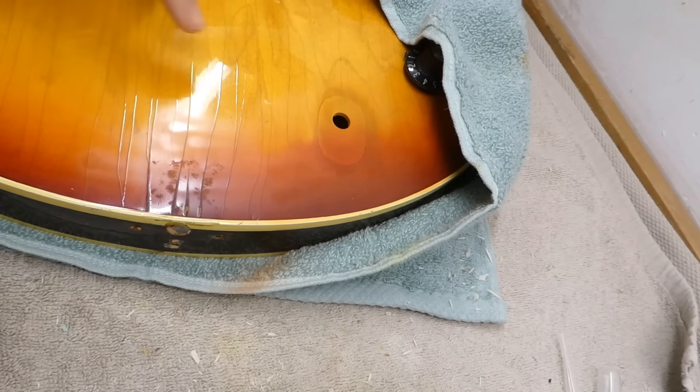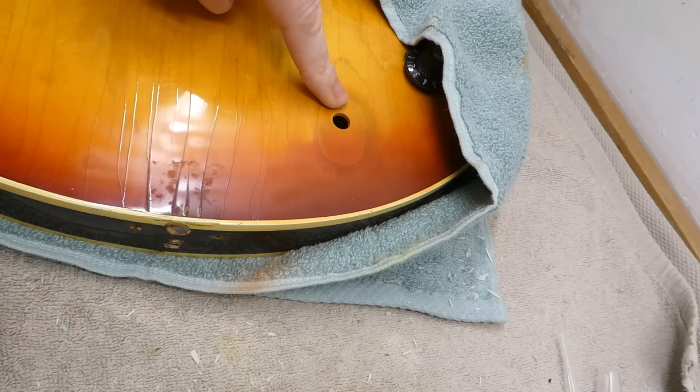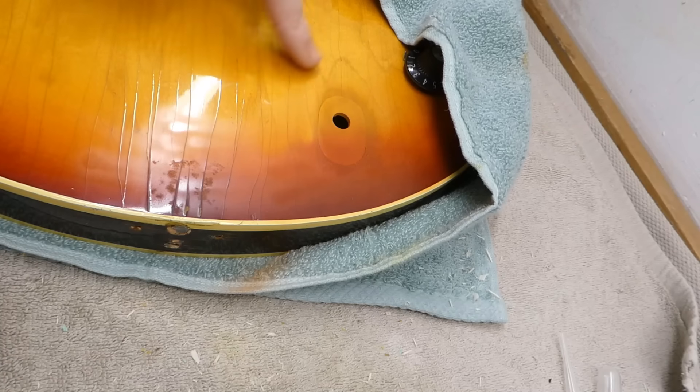There are times when you're trying to match a base color like this on a new patch, and if there's any overspray using a tinted finish like this, you're basically adding extra color onto the color that you're trying to match right around the patch. You can see it — sort of a darker hemisphere.